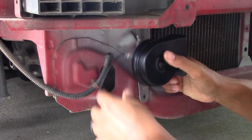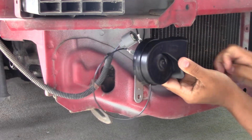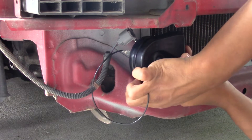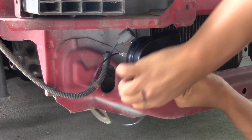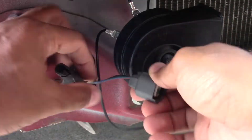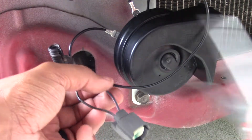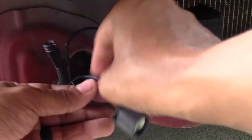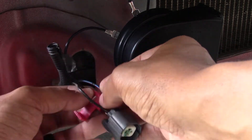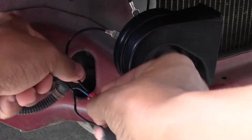At this stage I'm re-securing the new horn with the bracket. Make sure the ground wire is securely attached to the bracket at the horn location and that you have a secure attachment from the bracket to your actual car — this ensures a nice, complete ground. I'm tapping into just the blue wire since I've already established my ground with the car bracket. I cut the excess wire I don't need, use my T-tap to splice into the power, secure that in, and get it installed correctly.